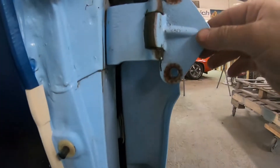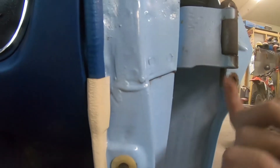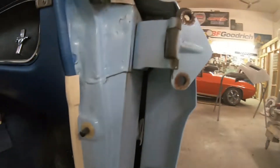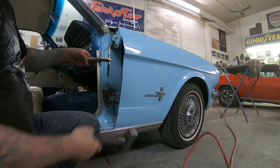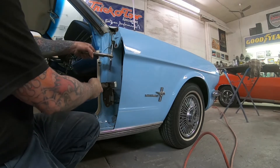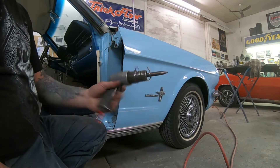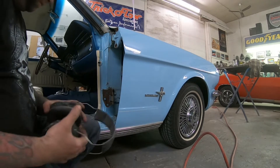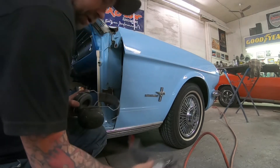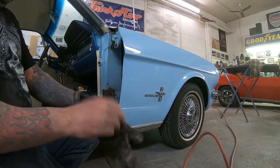Here's a better look at where we're getting all that play in the door — there's an awful lot of wear there. We're going to start by pounding these pins out. In this case from the bottom, I'm going to get a punch and a hammer and see if we can get that pin out without too much carnage. You don't have a lot of hammering room and they can be pretty stubborn, but if you keep working it you're going to get it. I usually use my air chisel with a pokey bit in there — give that a shot and see if she'll come loose. Always wear your ear protection while using one of these.